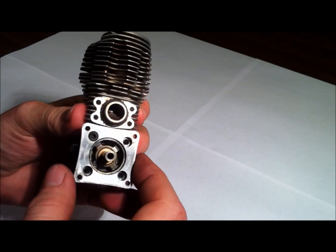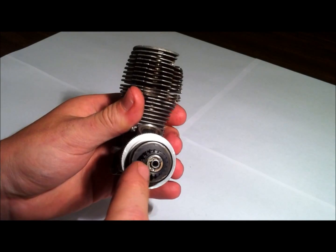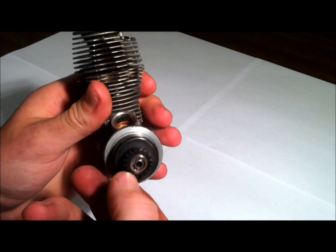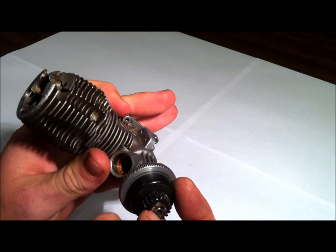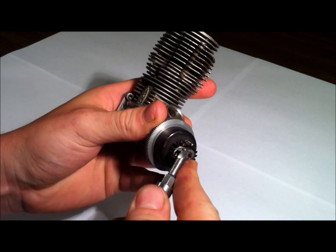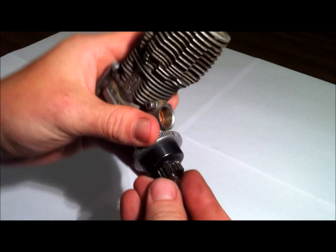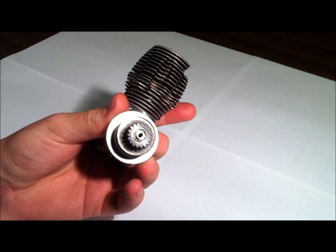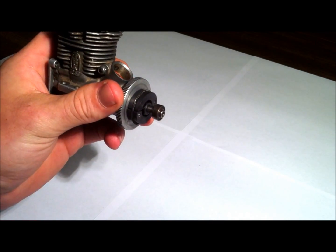Next, there's a backing plate here — I'm going to leave that on for now. Take the front here. So you got this little E-clip in the front. I'm going to pop that one out. Mine comes out with my fingernail, but some of them you got to use a screwdriver. Just take a little screwdriver and slide it right off. And you got a little washer there — pop that off. Make sure you save all your parts; you don't want to lose them. The washer is on there to space it out so the E-clip stays on. You got the little gear and the housing for the clutch — pop that off.